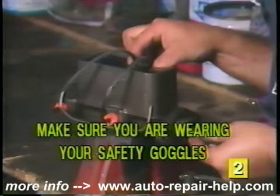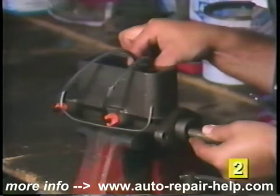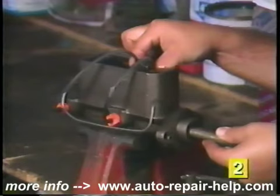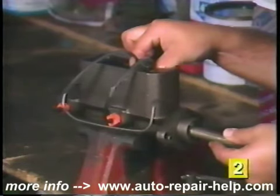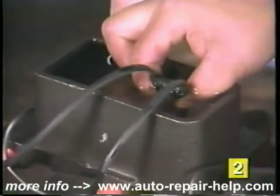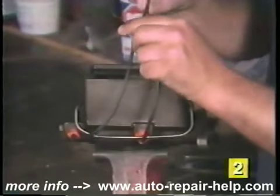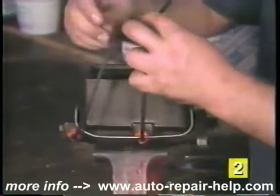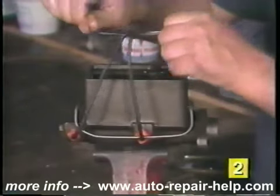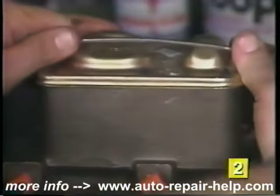When the piston has traveled its full stroke, squeeze both hoses closed against the dividing wall of the reservoir and allow the piston to return to its normal position. Make sure the hoses stay submerged in the brake fluid. Repeat this procedure until the fluid coming out of the ends of the tubing is completely free from any air bubbles. Remove the ends of the tubing from the fluid and tie the rubber tubing in a knot to prevent fluid spillage. Do not remove the tubing or fittings yet. Reinstall the master cylinder cover on the top of the master cylinder.